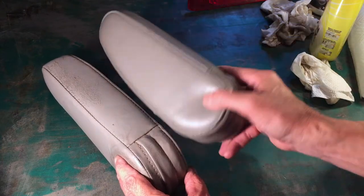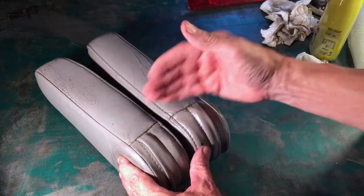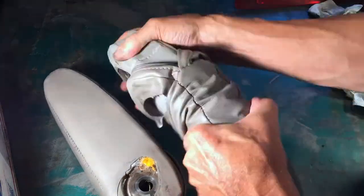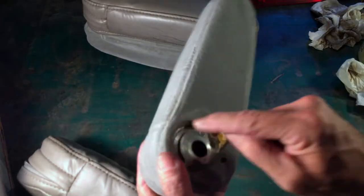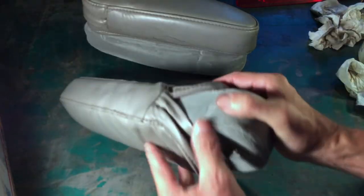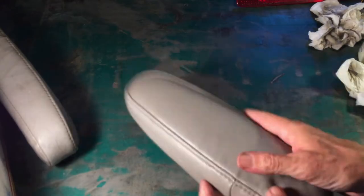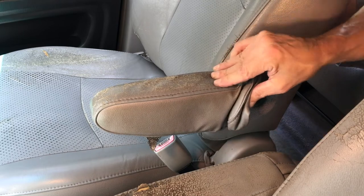The trade-off is that when we take the cover off and flip it over, we're going to see more of the seam that has the zipper — you can see how it's shorter here, and we're going to be seeing these sides. We want that groove on top and we also want the good side of the cover on top. This one goes on the passenger side and this will be the armrest for the driver's door. I need to find the zipper and peel it back so we can get to the 14 millimeter bolt that holds the armrest on.